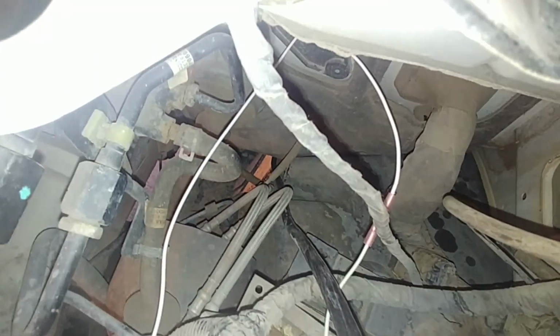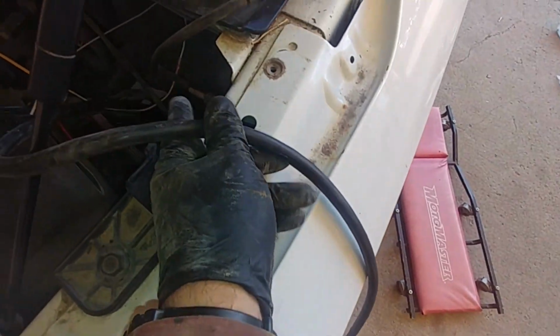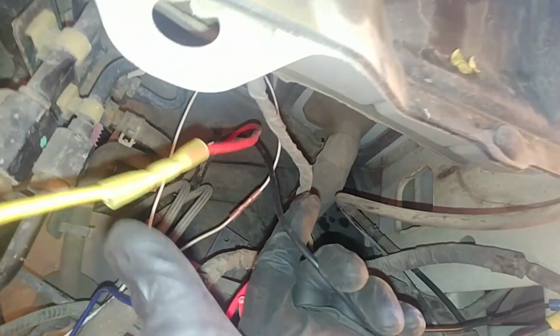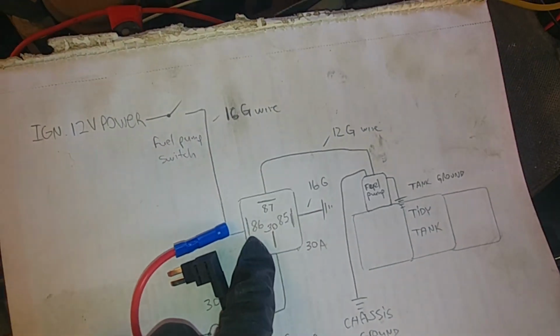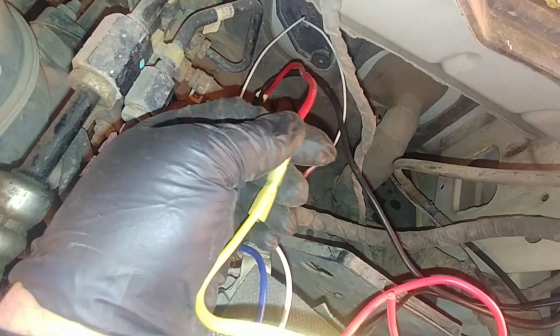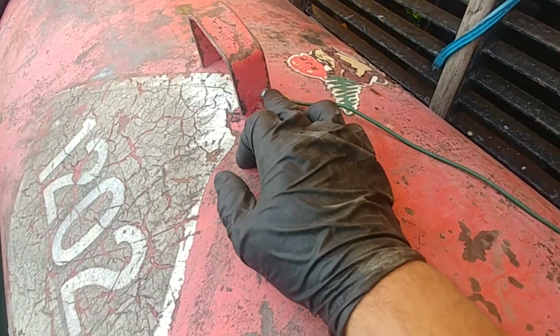And my wire is coming here, and as I already showed, this is my pigtail for the relay, and I have extra enough to get to my ground. This guy, which is coming from underneath, is connected. Power to pin 87. It's connected. Heat shrink crimp connectors. We'll get them sealed. And pump ground is connected to the tank.